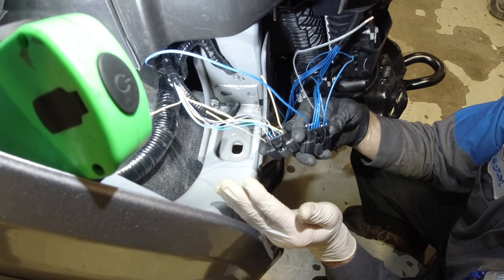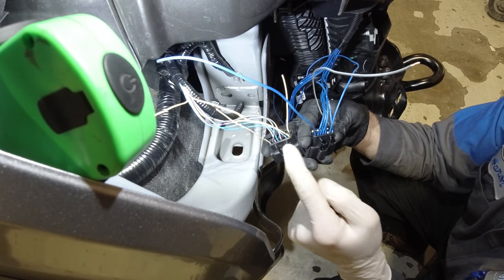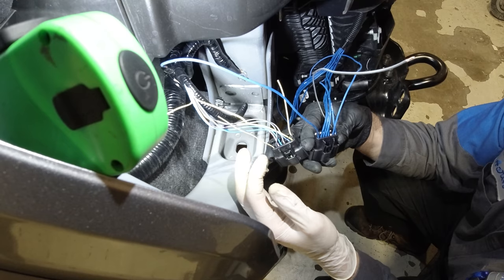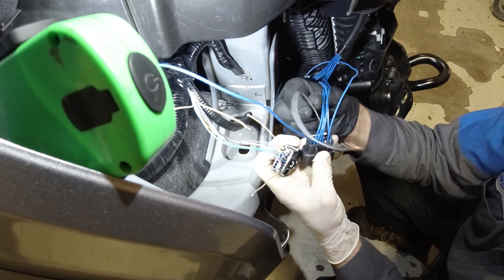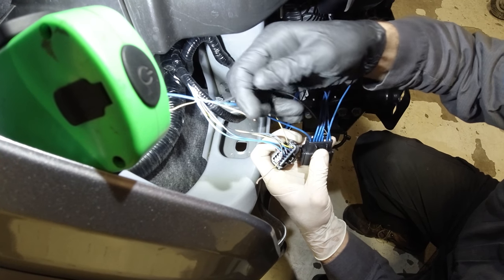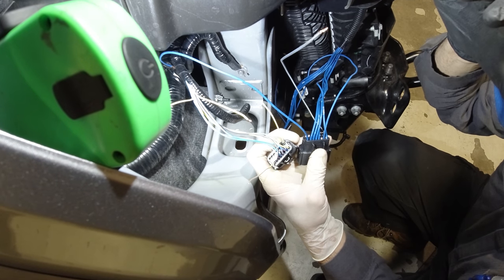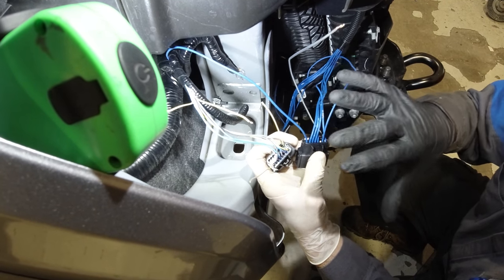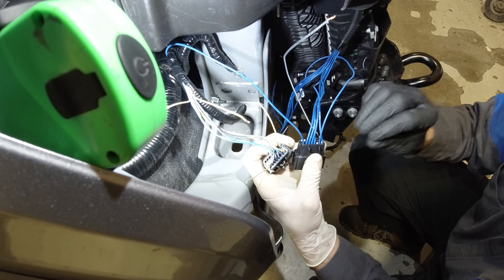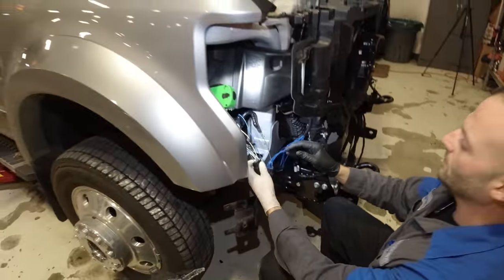We were about to give up, but then Sean started talking about why we have this extra wire down here, and I went into the wiring diagram and found out what this is controlling. I'm like, get out of here. Are you serious? What happens if I just add that circuit that we don't have, cut, and then just hook that up there? And everything worked. So I'm going to OE fasten all of this together, and I'm going to show you what it looks like prior to us installing it. Then we're going to put the headlight in, and then we're going to put the bumper on.